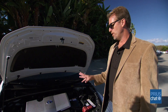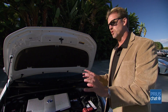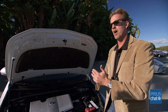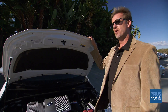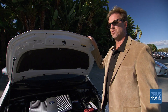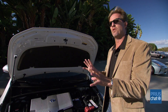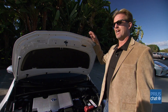What we shot for was to enhance the thermal efficiency of this engine — reducing the amount of energy lost to heat and getting more of it to go into power at your wheels. In the case of the 2016 Prius's engine, this new variation is now at a 40% thermal efficiency rating, which is the highest thermal efficiency rating of any engine in any mass-produced vehicle that I'm personally aware of. We beat the previous generation car, which was no slouch — it was in the 30s. And that was one of Chief Engineer Toyoshima's primary goals.